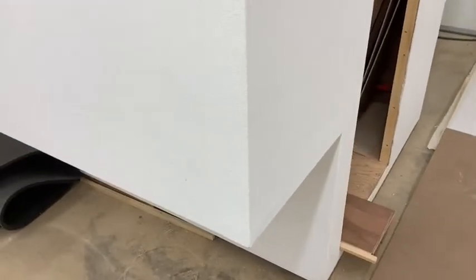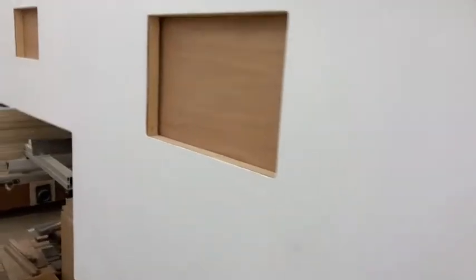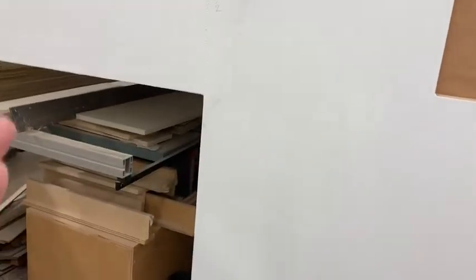I have to make sure I leave enough room at the bottom to hang down because there's going to be 1/4 inch molding going on the underside of the wings. And also under the cab over, on the front of the cab over and underneath. So I have little spacers to account for that molding as I'm laying the sides and the front and the back. We'll get to all that, but that's the procedure I'm making.